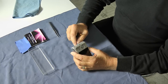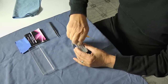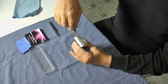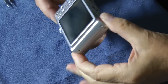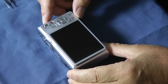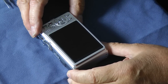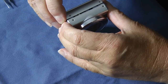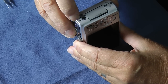I'll go ahead and remove the six screws now. Now I've removed the case screws we can remove the rear of the camera. In this particular camera the LCD screen is fitted to the inside of the rear camera case, and the LCD is attached to the camera through ribbon cables, so when we start to split the camera it's important that you don't pull the camera case up directly without freeing the ribbon cables from the clips.